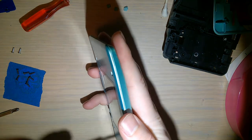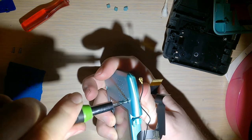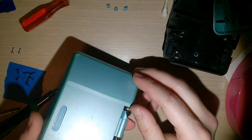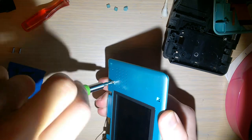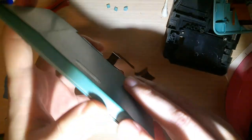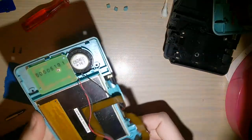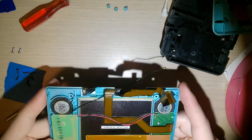These Phillips screws are the same screws that are in the motherboard. So far there are only two different types of screws: the black tri-wings and the silver Phillips - eight Phillips total and seven tri-wing. Once you've got those four screws, this is just held together with little snaps. I like to stick my thumbnail in there and just slide it along as the snaps release. This is still intact if I want to use that on another console. This is the part that's broke - two of the clips broke off.